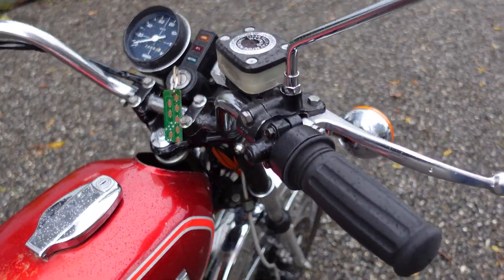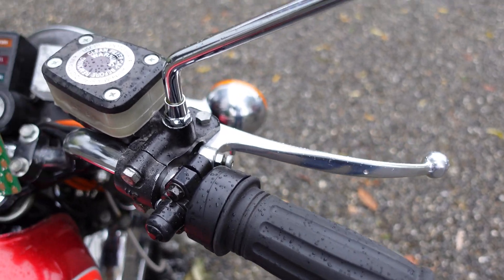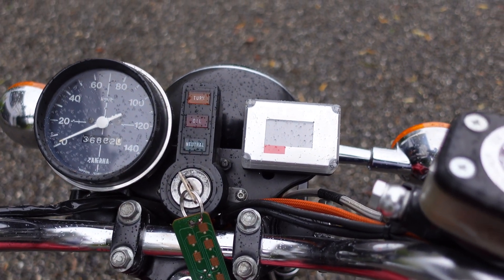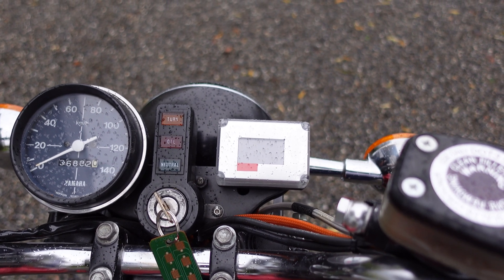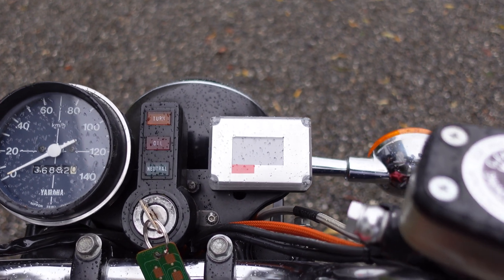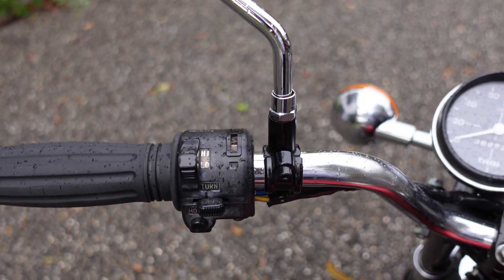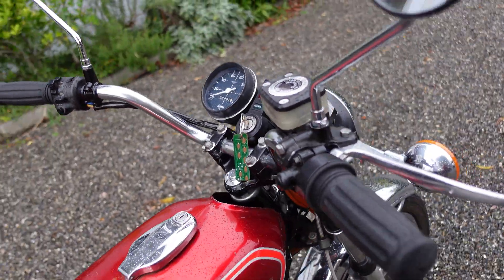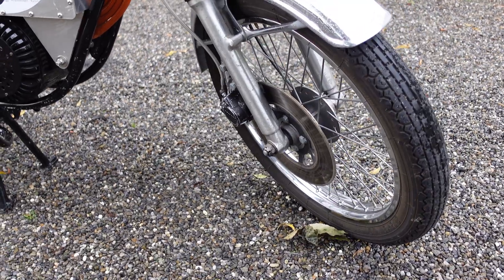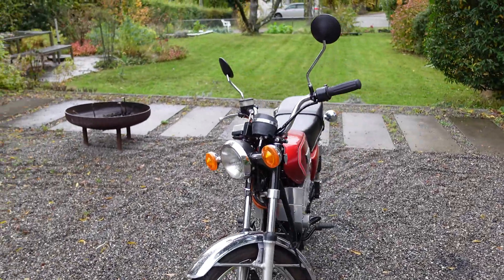On the handlebars we have a throttle combined with a front brake. We still have the speedometer and warning lights, although now instead of oil and neutral they mean batteries off and batteries on. There's also a battery meter which may eventually go into what was the rev counter. On the left side we still have the same controls for the lights but no clutch lever because there is no clutch. Up front we just have the original disc brake, and everything else is pretty much as it was when it was an RS125.